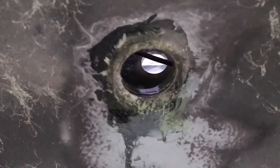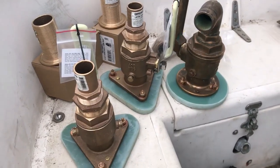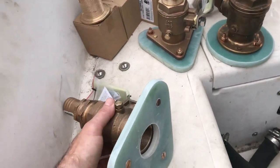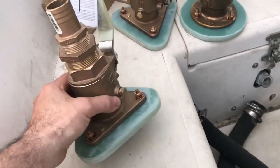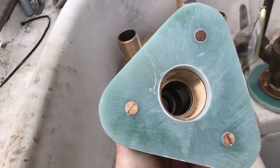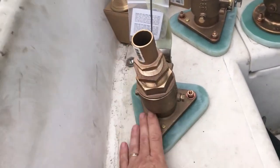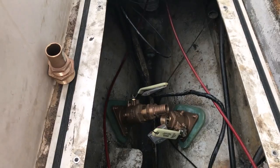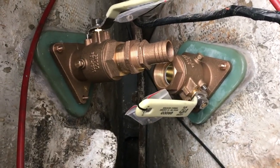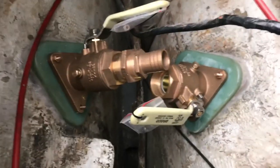Here's the finished product - the bowl is drilled and sanded down. I went over it with a couple coats of epoxy. For the seacocks for the cockpit drains, and also for the bilge pump, I was able to locate some G10 that wasn't outrageously priced. Cut it, shaped it, got the bronze screws pushed through the back, and I'm going to epoxy the whole backing block to the hull. The triangular backing blocks have been glassed to the hull with West Systems epoxy thickened with 406 and some chopped fiberglass.